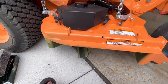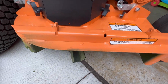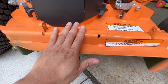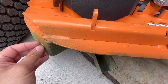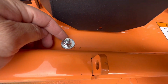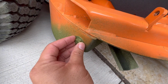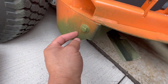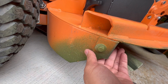After using a half-inch wrench to take out the deflector, the flap, we're going to have to remove what they call the turbo baffle from the outer deck. So it involves this half-inch bolt and also this nut here, I guess, before we can remove this assembly.